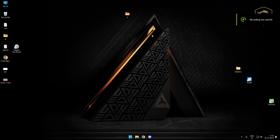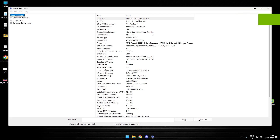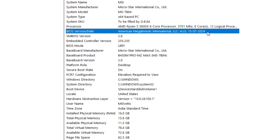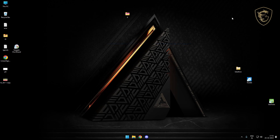I have booted into my machine. Let's go and have a look at the system information. Previously it was showing 2019, but now you can see after the BIOS update it has changed to 2024. I have also installed the new processor, the Ryzen 5 5600X, and since it's working, that clearly indicates that the BIOS update was successful.